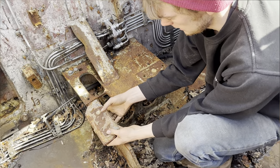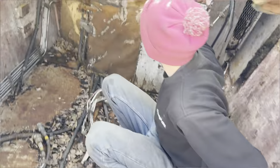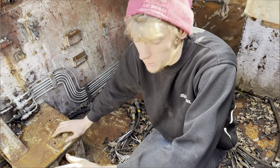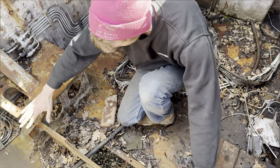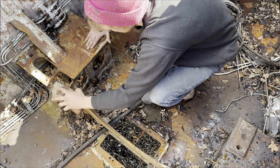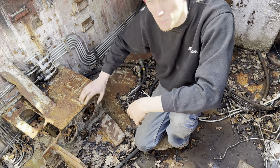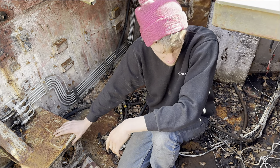I've thought about making a bracket. The engine bolts down on these two points here and goes in that hole there, so we know these points are still original and within tolerance. With Seb's Chieftain, which we're currently restoring with the engine out, I'm going to make a bracket mirroring those. I'll bolt the bracket here, which will hold everything in the right position at the right height, then I can weld up to it and weld them back in - and I know I'll be in the right place.